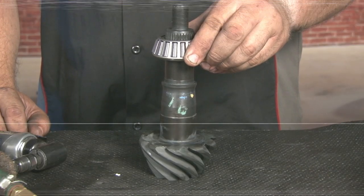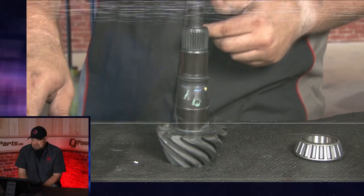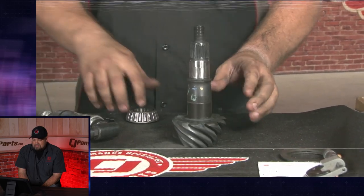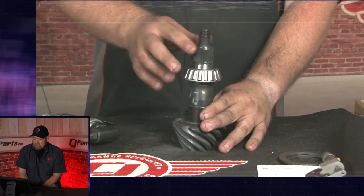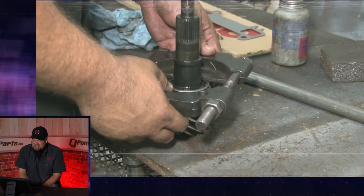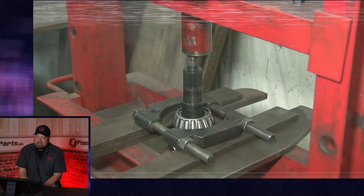The pinion bearing should slide down on the new pinion. We found with the Ford Racing gears with the coating they use, it doesn't go on smoothly. So cleaning the coating off this area here will make it install a lot easier. Here's the part that everybody cringes — I used the die grinder with a little cookie on it. If you want to heat it up or freeze it to do that, by all means go right ahead. I was taught years ago that you can do it that way and I've never had a problem with it. If you're careful and don't actually grind away the surface, and everything fits tightly, you won't have any problems.